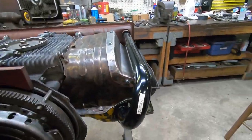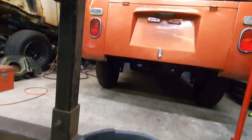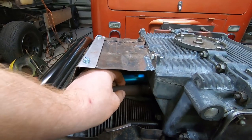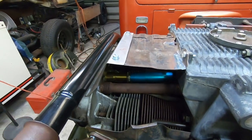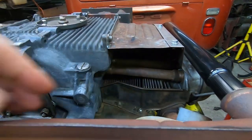Some expandable pushrod tubes will arrive tomorrow because when I was drilling this hole, my drill bit went in too far and put a small hole in the pushrod tube right behind that point. Since these are already kind of rusty and one is banged up from whoever put the previous expandable tube in, let's just replace all four. I've got a set of eight coming. Let's get started — take off the cooling tin and rig up a way to flush the engine.